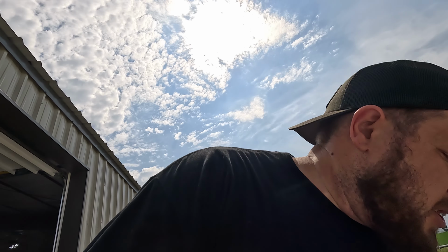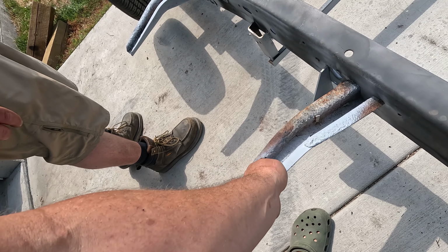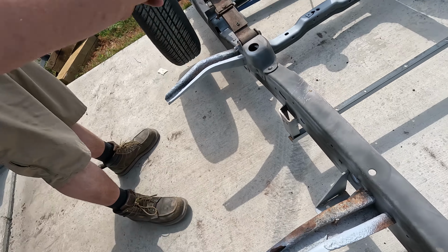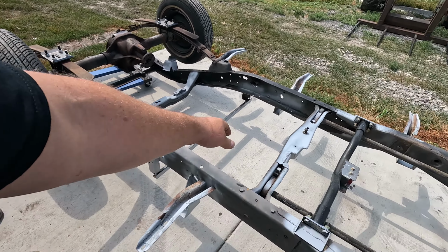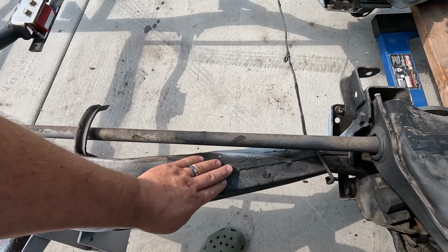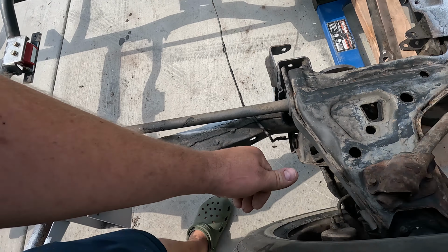And so now we're going to get some of the parts that we couldn't get that were really difficult. Like under here is a couple of these big chunks. I just wanna scrape off real quick anything that's loose. Under there, it's bare, we'll prime. But stuff like that right there, that's undercoating, so that can stay. This stuff right here, that's grease. See how greasy that sucker is? So we're just gonna do some more cleanup like that, then we're good to paint.